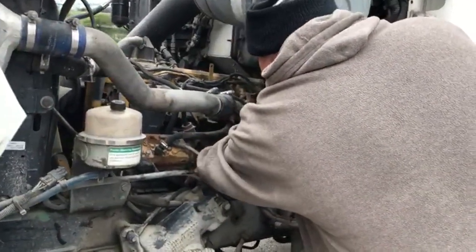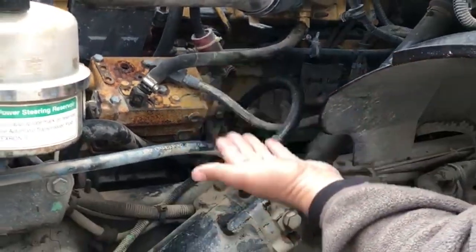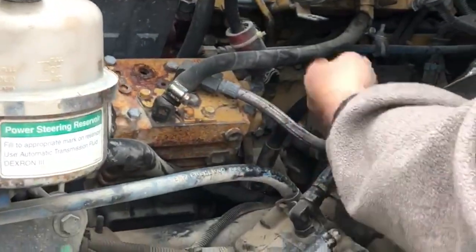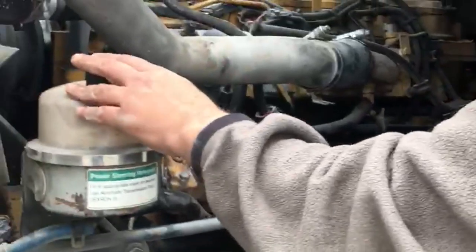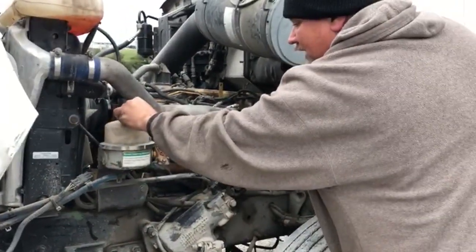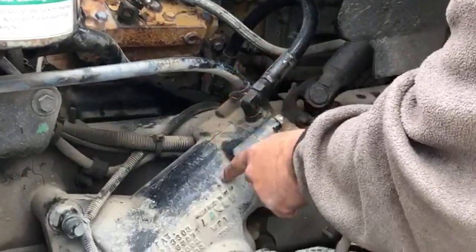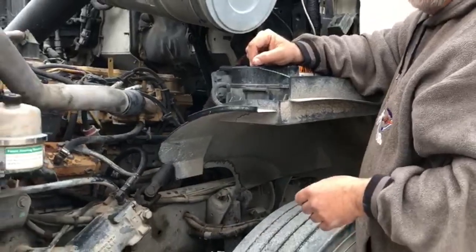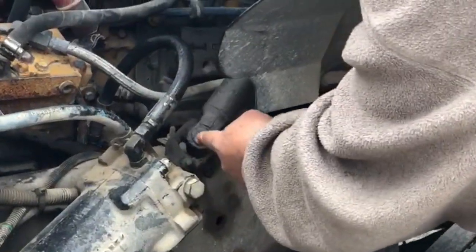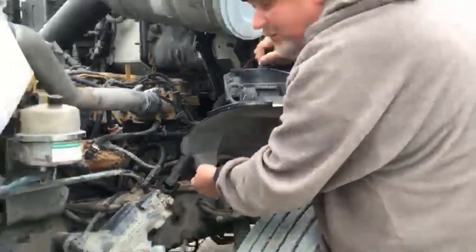I go down here. This is the steering pump. The steering pump is properly mounted and secured to the engine. It's gear driven. No missing bolts, no illegal welds, no illegal repairs, and it's in good condition. Hoses are properly attached — no cuts and no leaks. I follow this hose and arrive at the power steering reservoir. It's plastic — no crack, no block, no damage. It's at proper level, cap is pressing and tight, and the clamps are pressed and tight. I follow this hose to the steering box or gear box: properly mounted and secured to the frame. No illegal welds, no illegal repairs, and it's in good condition. I check the U-joints: properly mounted and secured. No crack, no break, no damage, no illegal welds, no illegal repairs, and full grease.